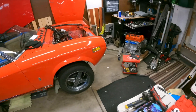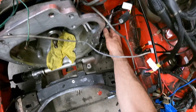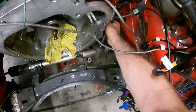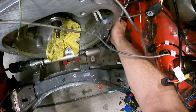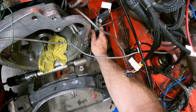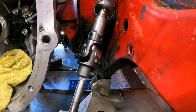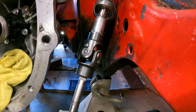Okay, finished product. The idea is this is going to scroll right up in there. There's a certain pattern and you have to line it up and make it fit just right — right about there is where it's going to end up sitting. So we've got the rack and pinion installed and attached to the steering arms in the car, and I'm testing to see what throw or distance I get on the turn of the wheels and if I have any resistance or drag.